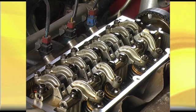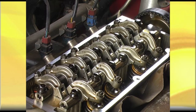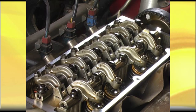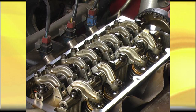We can see this one is going down, so when it comes up the inlets will start to open. Bringing it up — there you go, you can see the inlets starting to open. That's now on overlap, so we're going to set number four.